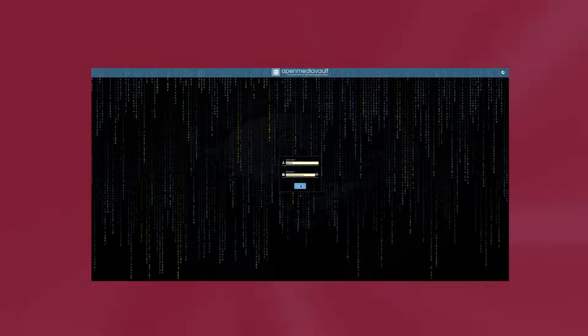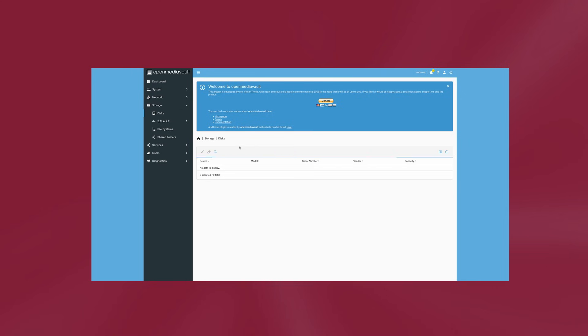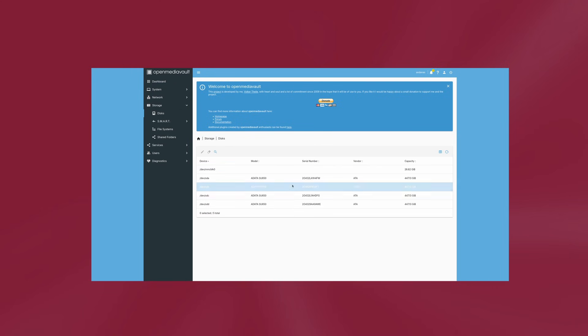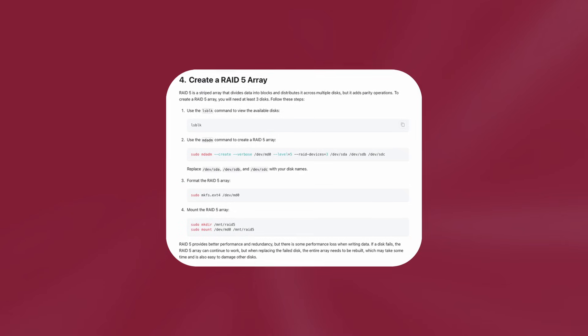After that, type in the local IP address assigned to your Raspberry Pi into your browser, and OpenMediaVault will open. The login details are admin and openmediavault as the password — but make sure you change those. Normally we'd use the OpenMediaVault GUI to create file systems, but because it only supports RAID 0, 1, or 10, we'll actually use mdadm to create our own RAID 5 array. There's a great Radxa tutorial for this on their website, also linked in the description.